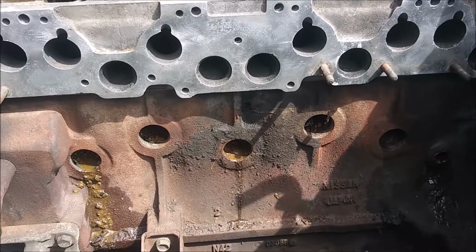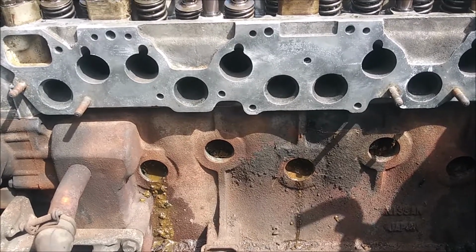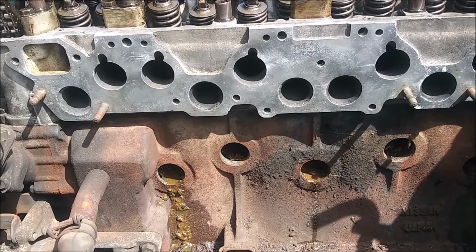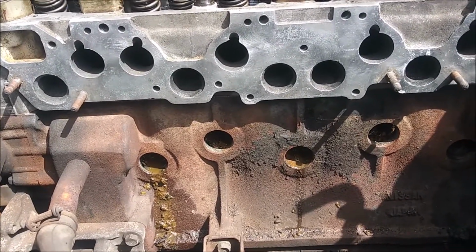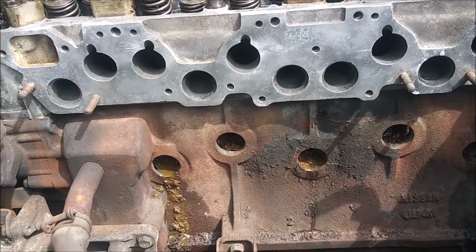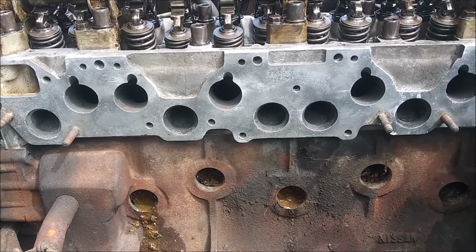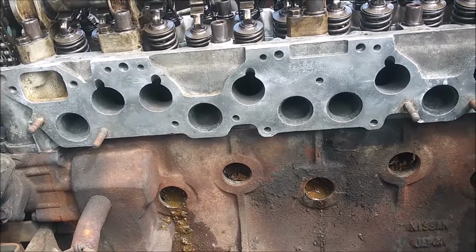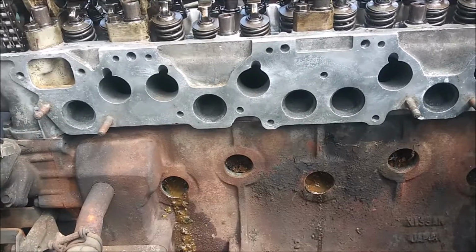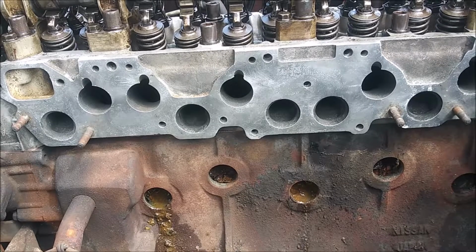I mean, theoretically, it is restorable. You tear it all apart, take it to the machine shop, they'll hot dip the block in the acid tank, and of course bake all the grease out of it. That'll pretty much take all the rust out. But I'm concerned that the cylinder jugs are compromised, and they could start cracking, which will then leak exhaust gases into the coolant system again, therefore rendering the coolant inoperable, because you got 1200 degree gases going into a 120 degree coolant system, thereabout, thus making the coolant a lot hotter, so it's not cooling down the engine. And also, because it's got a crack in the cylinder, it'll leak coolant into the cylinder, thus causing the white smoke out of the exhaust pipe, and that sweet smell that you get from burning coolant.